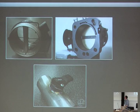Here's an example of each sensor. The MAF sensor — otherwise known as a hot wire sensor — heats one of the wires up to a known value, and the amount of air passing over those wires will cool them at a fixed rate. The throttle position switch has a little knob that hooks up to a variable resistor — as it turns, you can see how open or closed the throttle is and estimate how much air is getting in. Down the bottom is a manifold pressure sensor, which measures absolute pressure between a given range. Interestingly, only two of these methods actually measure air — the MAF and the MAP sensor. The TPS will simply try to guess how much air is passing through based on how hard you're pressing the throttle.